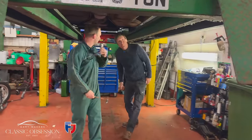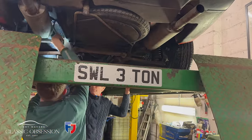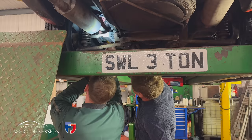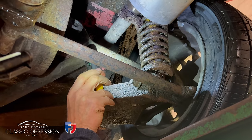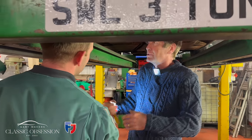The first thing we're going to look at is the chassis, because typically they are bad for corrosion. Looking up there — we've got a problem. You can see where it's starting to go through; it's very thin now. I got it up a few days ago and noticed this shock was basically pissing out fluid. The shocks look like they've been there since the car was new — they're Armstrong shocks originally. Colin Chapman at Lotus was so meticulous he used to drive the people at Armstrong mad, checking through so many and deciding which was the right one. Each car was individual and hand-built.